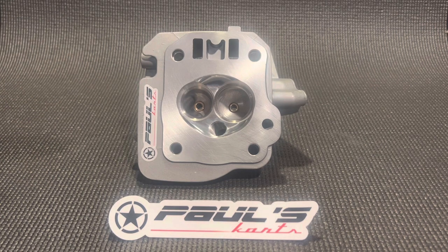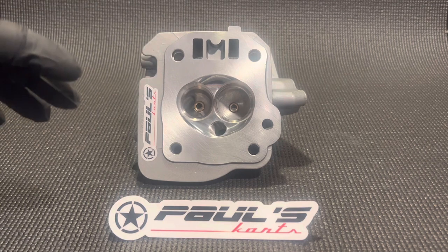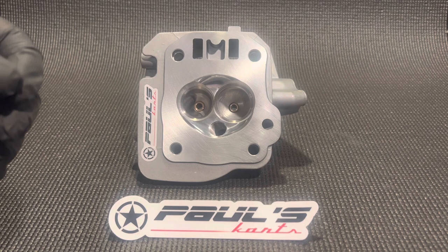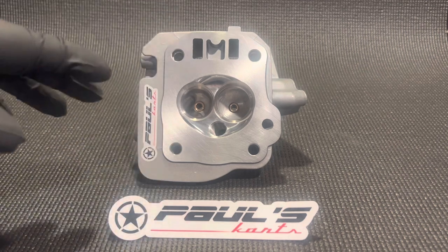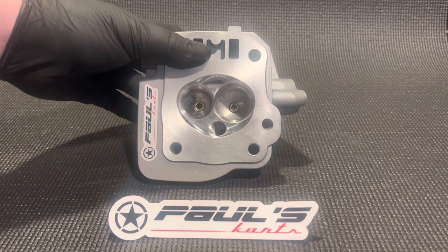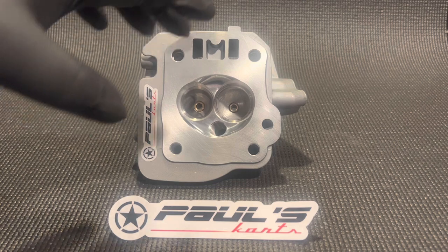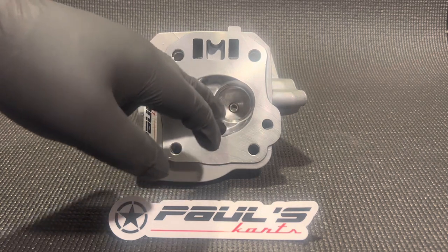What you're doing with velocity is you're trading pressure for flow. So CFM or velocity — when you increase the velocity, you're actually decreasing the pressure. It sounds crazy, because every time I hear that I'm thinking of a pressure washer and how much pressure comes out of that, and you know it's high velocity. But fluid dynamics and air dynamics are different. If you look it up: as velocity increases, pressure decreases. So what you're trying to do in the port when you increase that velocity is basically give a pressure change to the charge right at the seat.